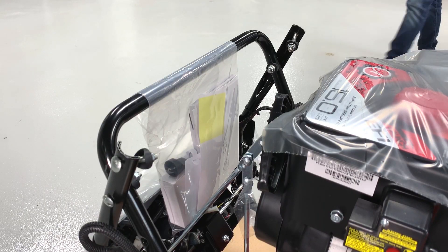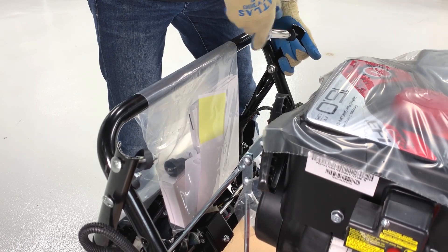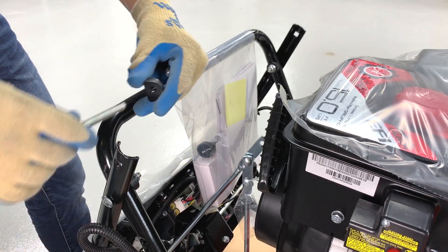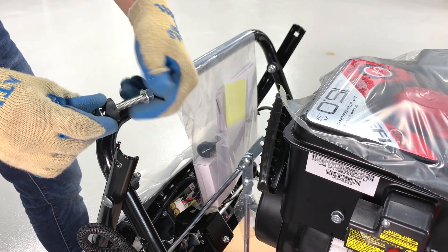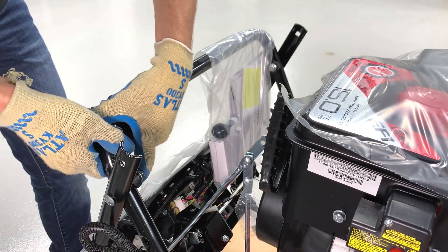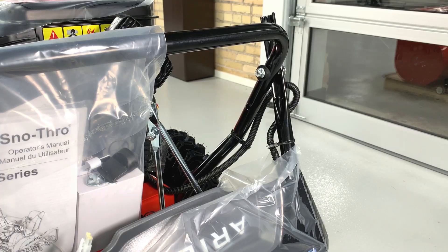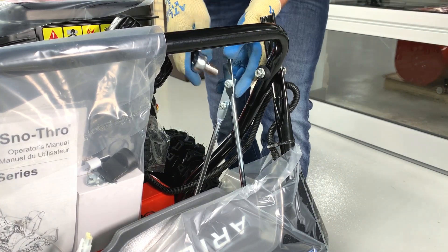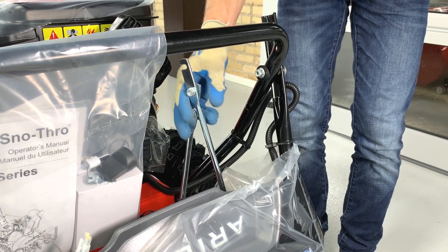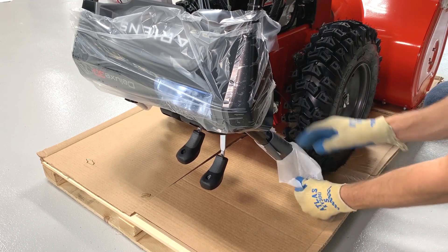If the literature pack was loose in the box, wrap it around the handlebars as shown here. Remove the hardware sets that are only through the upper handlebars and set them aside. Loosen, but do not remove, the hardware retaining the upper handlebar assembly to the lower handlebars. Also loosen the shift rod hardware. Remove the wrapping from around the hand grips — the clutch levers will spring back when the wrapping is removed.